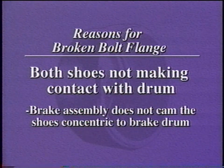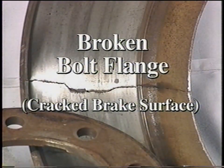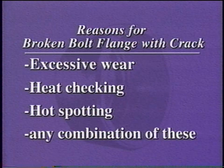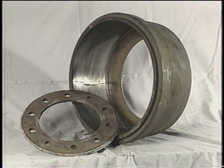This is caused by a brake assembly which does not cam the shoes concentric to the brake drum. This is a failure mode that occurs when the brake surface is cracked through due to excessive wear, heat checking, or hot spotting, or any combination of the above. The expanding shoes are then sometimes able to unwrap the brake drum structure from the bolting flange without it breaking